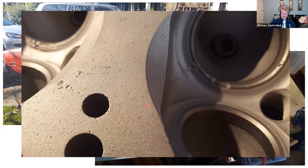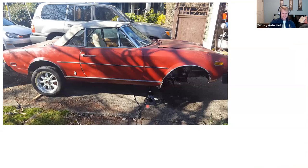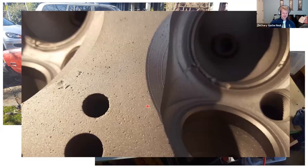What's also interesting is that the Fiat is notorious for having parts break down on it. My father was talking with a machinist who specializes in Fiat parts, and he said the engine blocks have always been notorious for low quality. I think it's pretty evident from this high porosity that these are kind of poor materials.